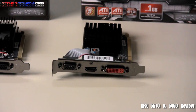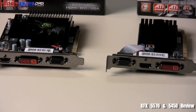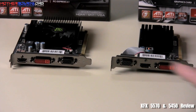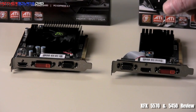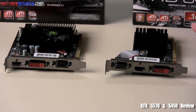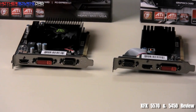Here we take a look at both retail cards themselves. Notice there are a few similarities — both rear IOs are almost identical as far as features go, though the setup is a little different. The DVI connector is located in a different spot, as is the VGA, but they all three contain the same thing: a DVI, a single VGA, and an HDMI connector. The only other differences are the card height, and that the 5570 has an active cooling solution while the 5450 has a passive cooling solution. Neither one requires any power connector whatsoever, so those looking to upgrade will probably be fine using their old 350 or 400 watt power supplies.